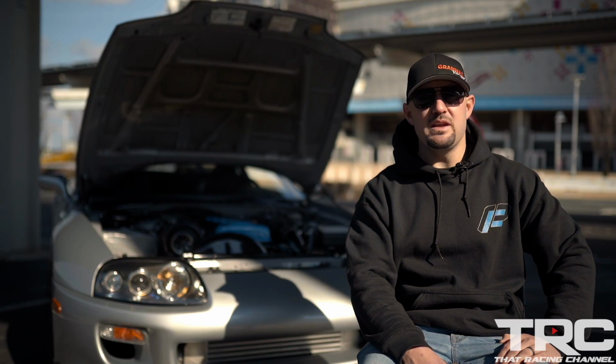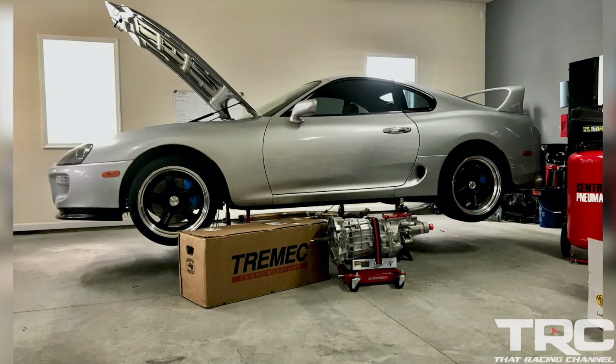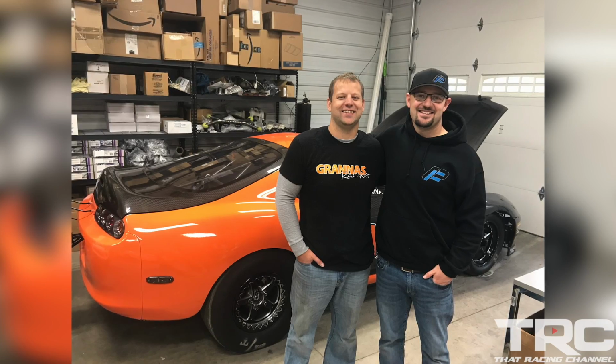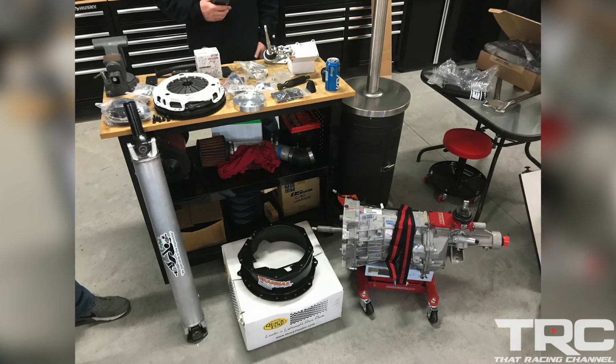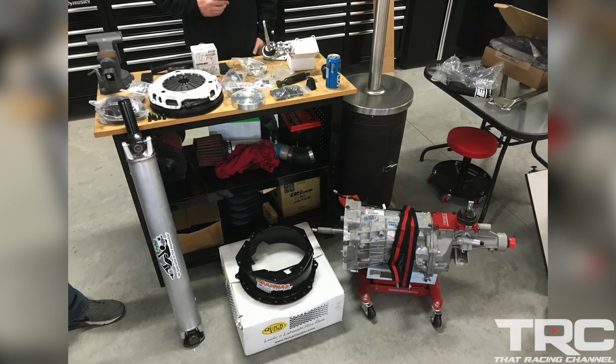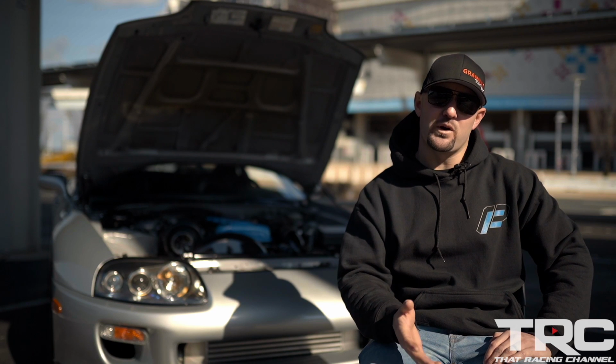This car is a little bit unique in the fact that it is running a T56 Magnum. Joel Granis of Granis Racing was kind enough to sponsor the car last year, and I did an entire build series on that. It is running a McLeod twin disc clutch also, with a Sickie short throw shifter. Currently the drive shaft in it is from Drive Shaft Shop. It is an aluminum 4-inch drive shaft.